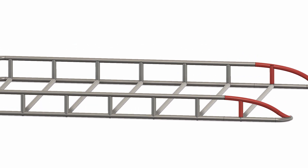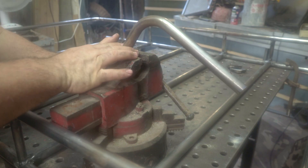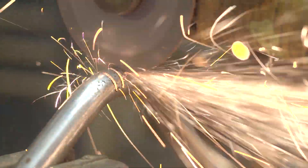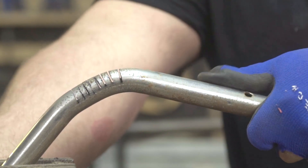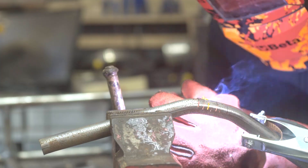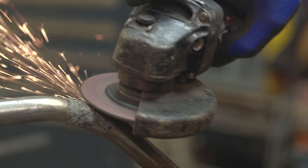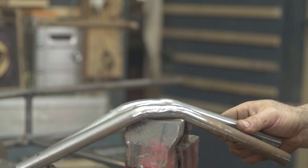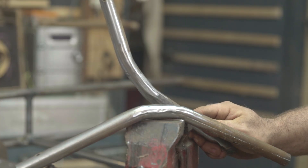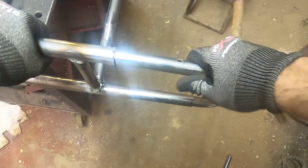The tedious part is fabricating a piece with a much weirder shape — a much longer corner that is not 90 degrees. Let me show you how I approach this problem. First, I take the 90-degree corner from the table and place a sturdy vice on the table with the tube inside. With my angle grinder I make some cuts — they don't need to be perfectly spaced, but it's important to have the same number of cuts on both tubes. After applying some force I can change the angle from a 90-degree corner to a 60-degree corner, then weld back all the cuts.